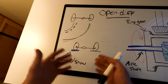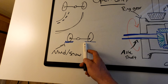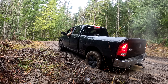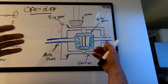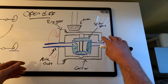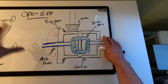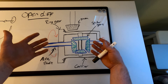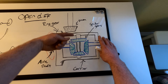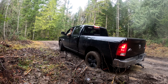Now here's how this relates to what we just did. Here's my drawing — this is a tire in mud and this is a tire on a grippier surface. As we saw, the tire in the mud spun and the other tire didn't really spin at all. Going back to the cutout: torque takes the path of least resistance. If one wheel has more friction, torque coming into the carrier will go to the wheel with the least friction. So that axle stayed put as power came through the ring gear, through the carrier, through the spider gear assembly — and transferred power out to the spinning wheel.